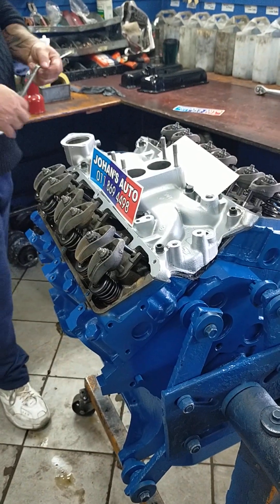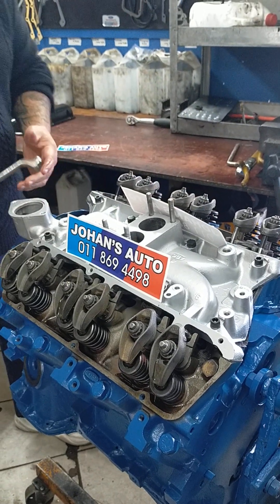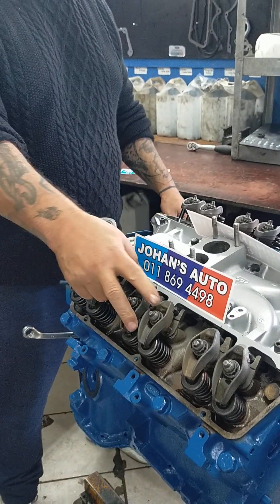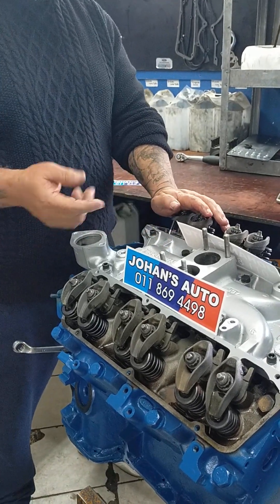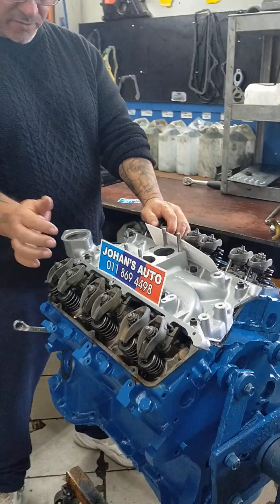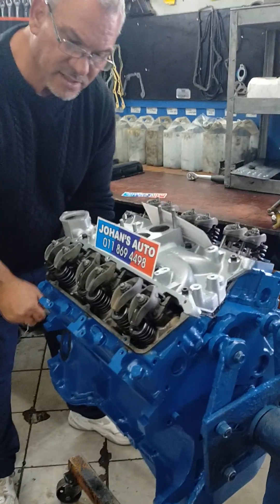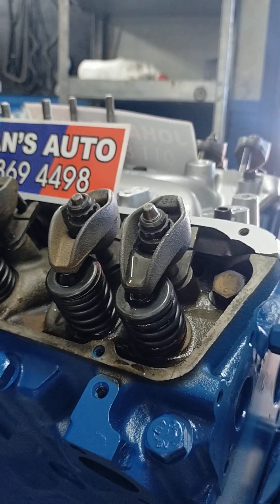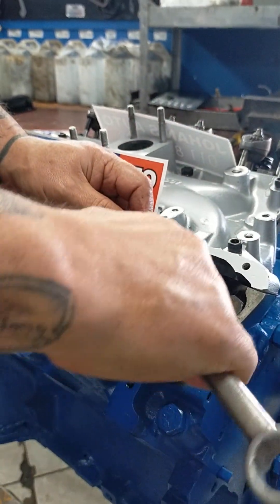I've got to turn it up. So it's one, four — the next one will be two. Two is here. For rock two, we're going to go to six. Again, I'm going to recap: rock five, set one. Now if you go in your firing order, a lot of people ask for the firing order but it's printed on your intake: 1, 4, 2, 5, 3, 6. So we've done one, we've done four, so we're going to go two. And to rock two, you're going to rock six. And if you do it properly, it will always be the next one in the sequence — straight away, they rock. I'm going to give this one a bit of a tighten. It is loose.